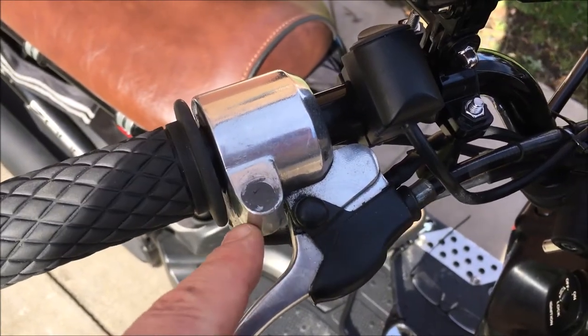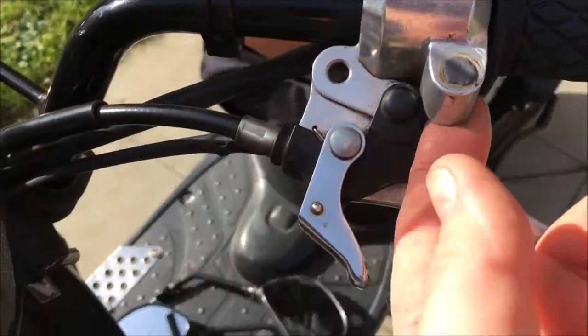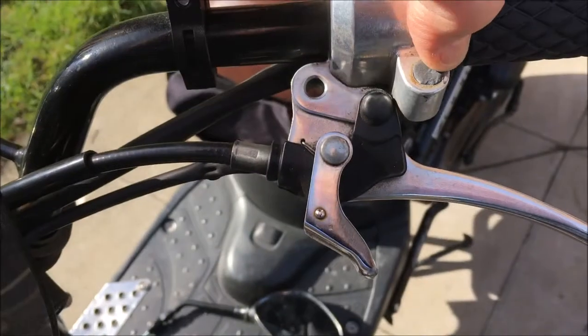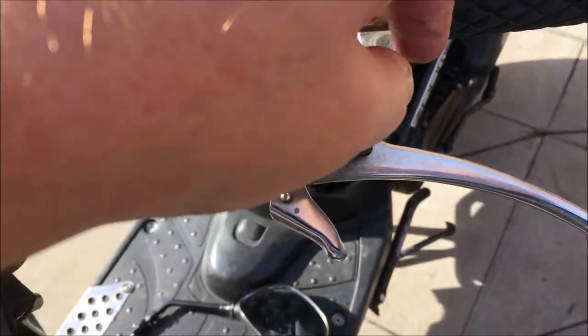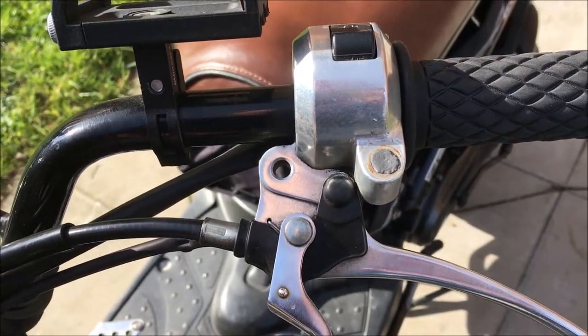Alright, so that's both holes filled, top and bottom, with the steel stick. This takes about an hour to fully cure. So while it's curing, we can go and get on with the wipe-down clean.